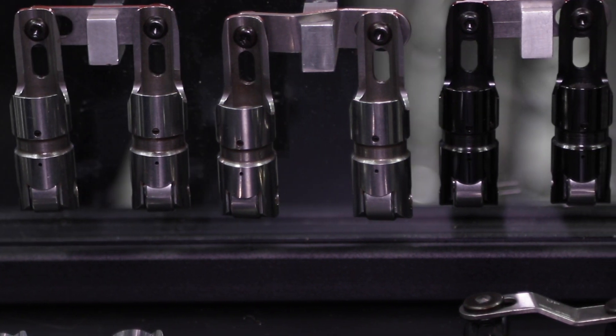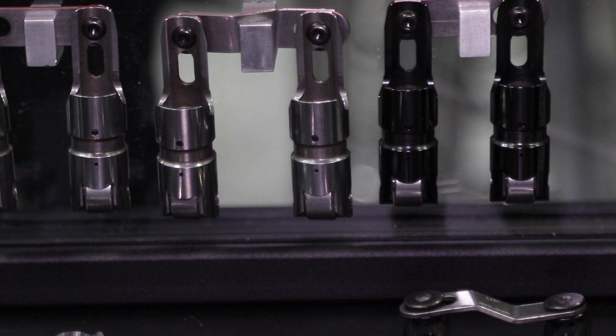Well, through extensive research and development that we've done here at Comp, what we've found is the ability to make a solid roller lifter that's lighter and stronger than ever before. It's a modular design with removable and replaceable pushrod seat cups, whether you're running a 5/16ths ball pushrod or 3/8ths. Whether you need extra clearance for large offsets or intake valves, we've got special pushrod seats with different offsets to accommodate that as well.